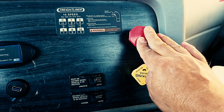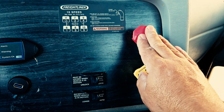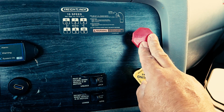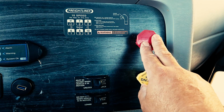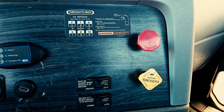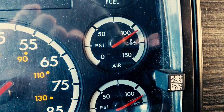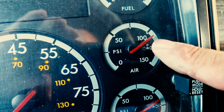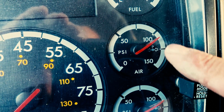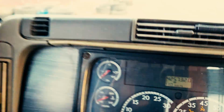This is your trailer air supply control valve and your tractor brakes. And this is how we supply air to the tanks on our trailer and to the chambers on our trailer, and also to release our emergency spring parking brakes on our trailer. Now we allowed our air to stabilize. We're taking a reading. We're going to ensure that we do not lose more than 4 psi in the period of 1 minute while we're depressing the service brake pedal for 60 seconds.